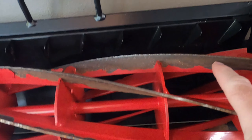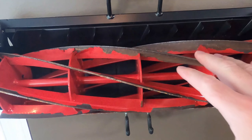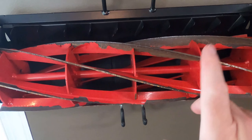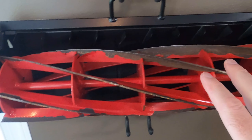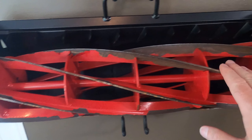In this tip I'm going to show you how to take care of your reel and try to prevent the paint from peeling off — see all the paint peeling here. This is the 10-blade reel; it looks really good because I haven't used it quite as much. This is my old six-blade reel. First, listen to how it sounds when it turns — it's squeaking. Now if we look at the other one, I intentionally washed it in one of my last videos. I'll put a link to that super clean video. I didn't treat it after washing — it needs a professional grind — but listen to how much smoother it sounds.